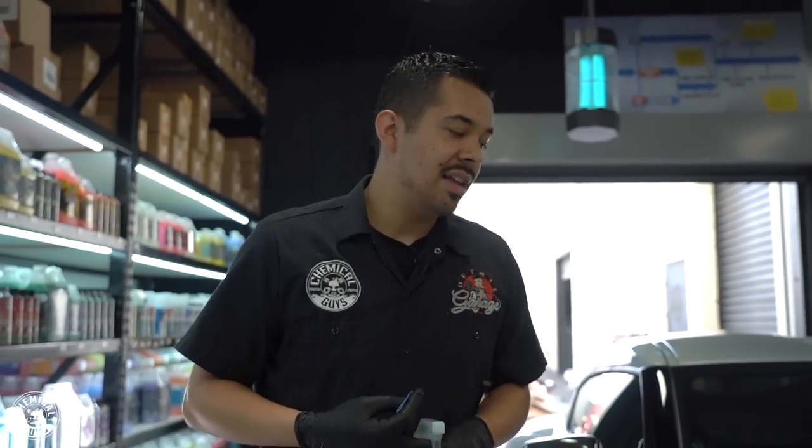So now that that's all said and done, I do want to mention that on this car, we did wipe it down prior to this video. We wiped it down with the waterless wash. And just with any other clay barring in your life, you want to make sure that the surface is clean. So either wash the vehicle, or you can wipe it down with a detail spray or a waterless wash, depending on how dirty it is. So like I said, this is the clay lubricant.